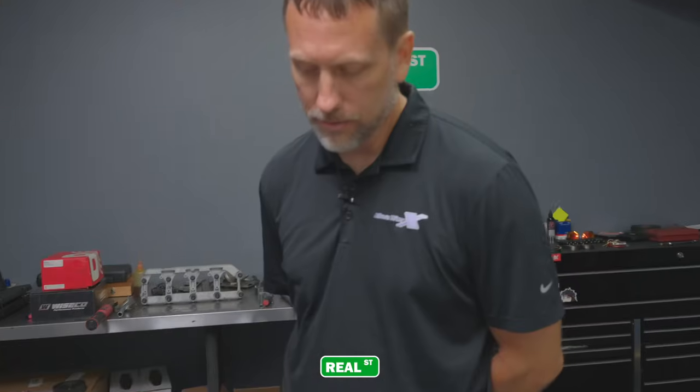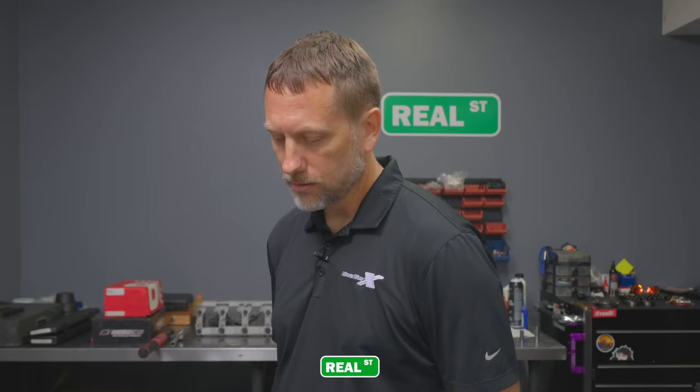we upgrade all the motors that we build to the five hole bearing. And what did you see in your experience with the engine, that the five hole bearing offered a benefit? Well, it definitely increased flow to the rod. And you can see the rod bearings handle more stress in the racing environment.